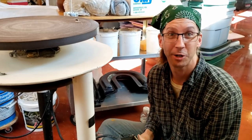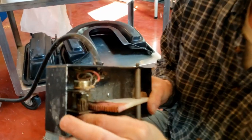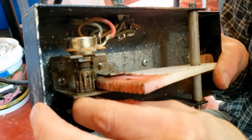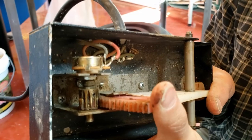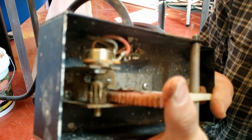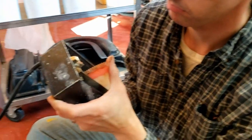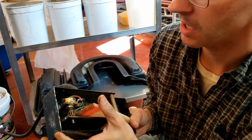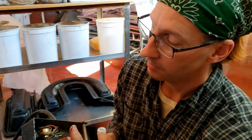So why does it mysteriously turn itself on and chug? Because this wasn't in the more-off position when you released it from the pedal. It also needed to be cleaned out in there a bit since it's never been taken apart. Is there any kind of grease fitting on this? No, it's a potentiometer — it's a mechanical component that shouldn't need grease at all. Then why is it so greasy? It just got dirty.